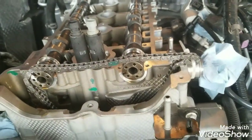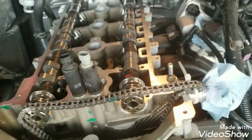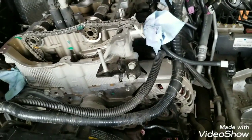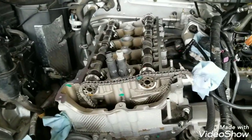The cam sprockets are off and the chain came right off. I did a zip tie on the side so it doesn't fall in there, so it's nice and tight right now. I will be holding it on when I take off the head. Hopefully I don't have to take off all the gear gaskets and gear covers to keep it in place. Next, we're going to try to take the head off — I'll probably remove the cams first and then go from there. I've got four more bolts left — there are the star-shaped ones, I think it's like an E12. Regular 10mm works just fine as long as you're being careful, since I don't have that other socket set right now. So I'll be taking those off right now and it should be able to lift up.